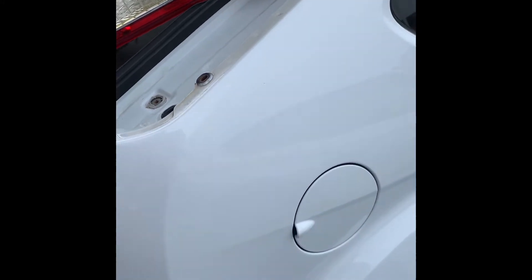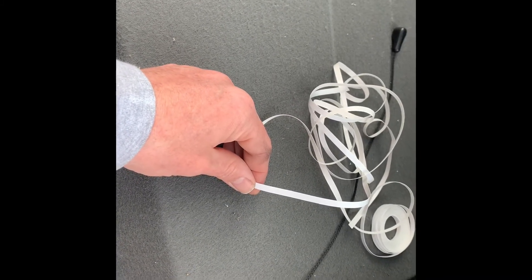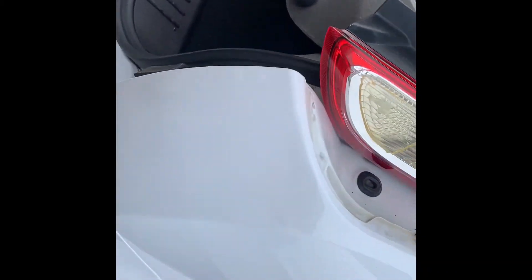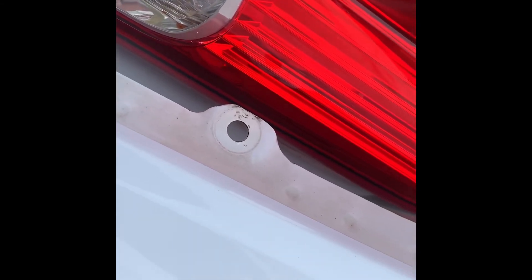Let's get some on and see if it looks any better. As we can see guys, there's the pinstripe — it's fully waterproof tape, gloss finish, pretty much matches the standard white colour. As you can see there, it just sits along the edge, goes round corners quite nicely. You use heat with it to make it adhere properly — it just runs up, and that'll stop the lacquer from travelling or flaking anymore.